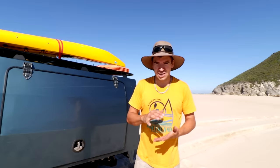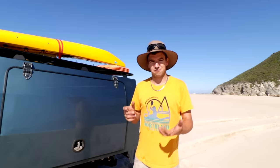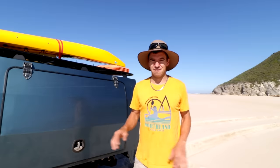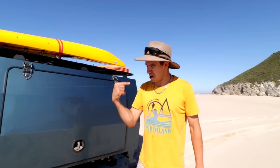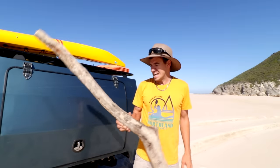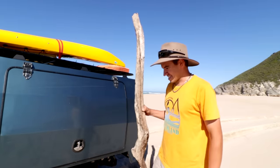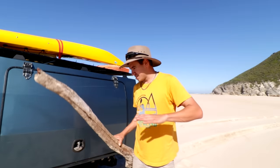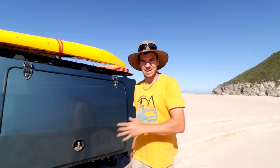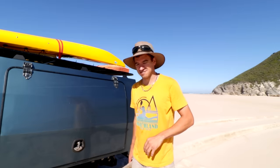I'm going to show you how to virtually dig yourself out of this situation, because that's the only way you can do it. If you've got a high-lift jack or any recovery gear that'd be awesome - an exhaust jack would be perfect right now. But in this situation I've got no recovery gear because some dummy left it at home. Pretty much what we want to do is work our way around the car and clear any sand from under the chassis, under the axles, under the bash plates, so the car is once again sitting on its own wheels.